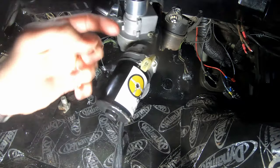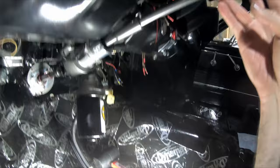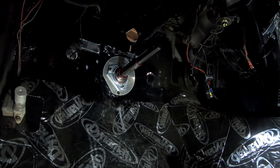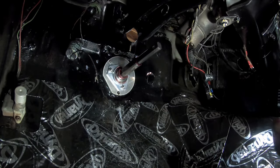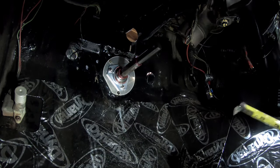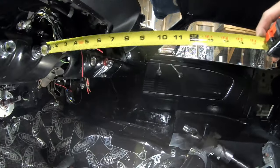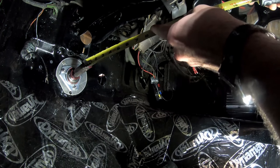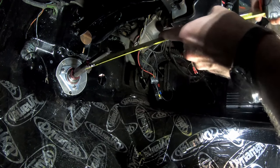I think I've got it to a point where it might be good. I did have to remove this whole motor assembly and right now I'm going to put it back in place to test fit it. This thing is deceivingly heavy and it's such an awkward angle and reach. There we go — that's in. My goal has been to get this ring to this point right here. The motor was up here in place and the steering wheel just came too far towards me, so I believe this piece has to go in a little further. I'm lucky enough to have another 66 Mustang and I did a visual to see about where the tip of this assembly came out — about 10 and a half here, versus roughly nine or nine and a half on my other Mustang.